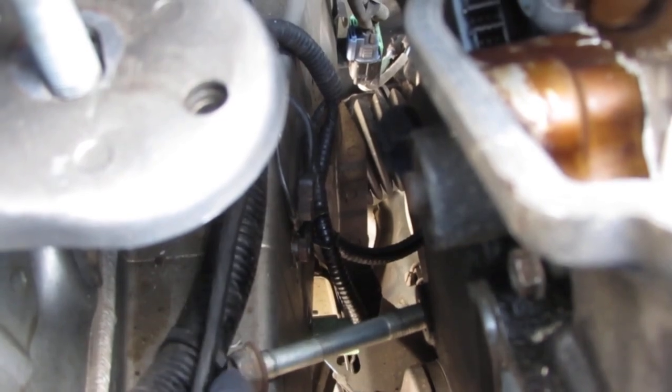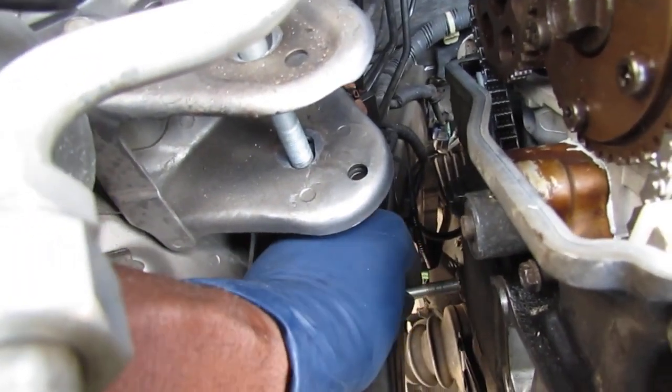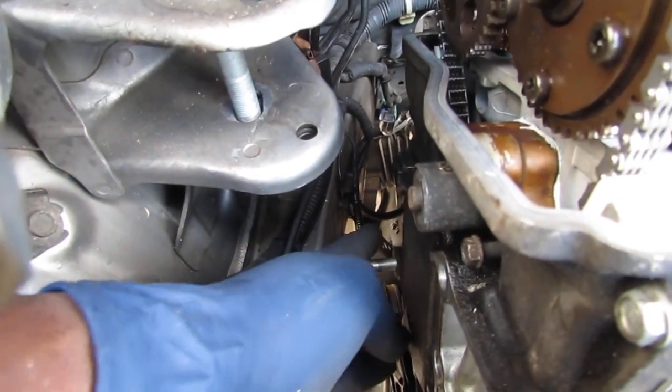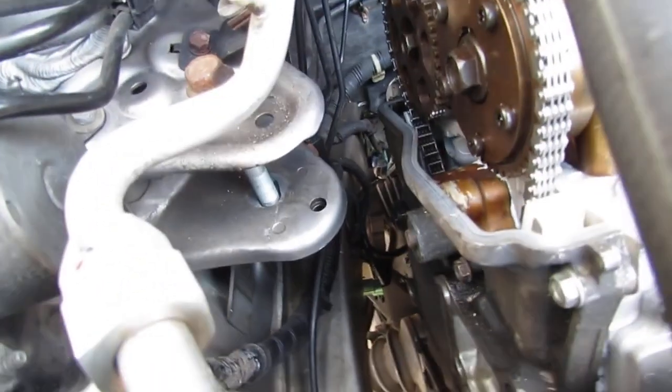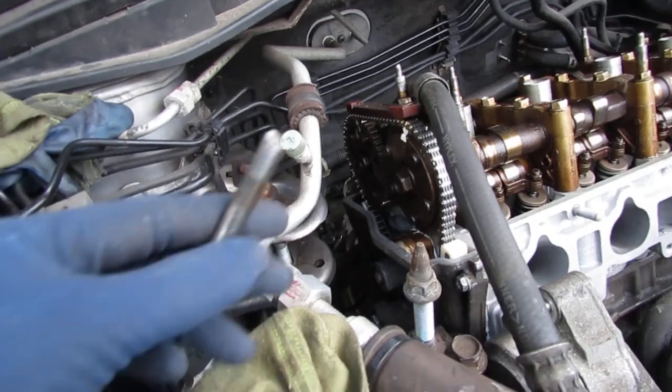I can't push up anymore because of that engine mount underneath that I attached, that I showed you earlier. I gotta disconnect it just so I can lift the engine up just like 2 inches or so more so I can slide that bolt in. Alright, so that's the order of things. Now, see, we can get the bolt in. So that's the sequence of order. Don't put that engine mount in until you get the side mount on first, at least the bracket.